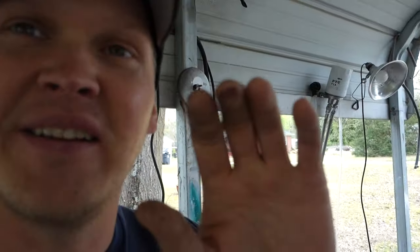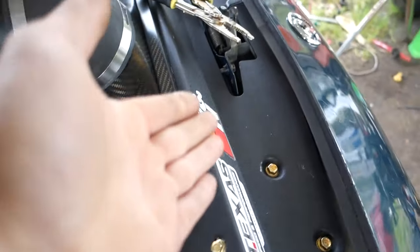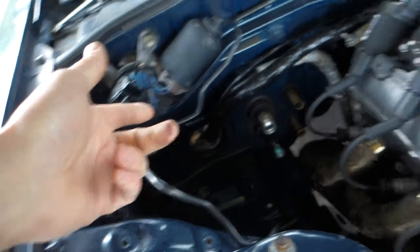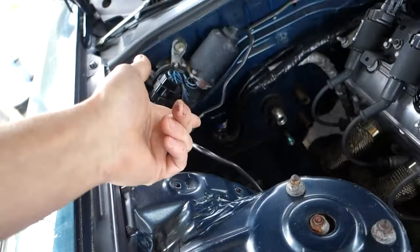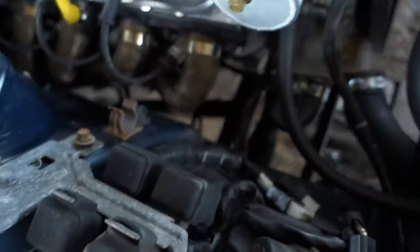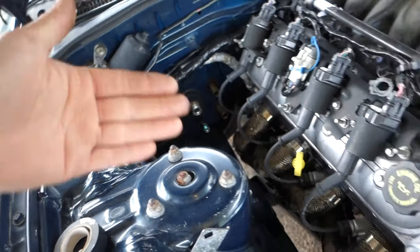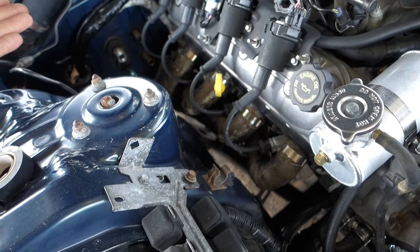I didn't record any of the electrical stuff because I destroyed my fingers — totally my fault. I made a small adapting harness to adapt to the fans I was running to the factory RX-7, went into the floor to where the ECU was, found the signal wire for the fans, and hooked that to the GM ECU. So now the GM ECU cuts the fans on when the engine reaches temperature — just like it should. I got the signal wire from the ECU hooked to the signal wire for the relay.